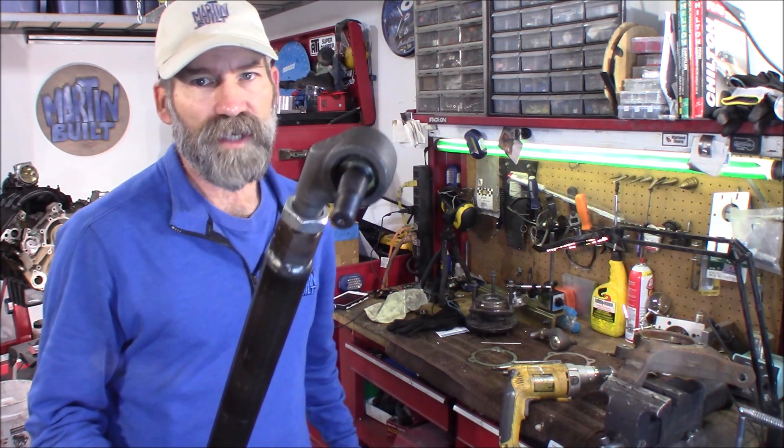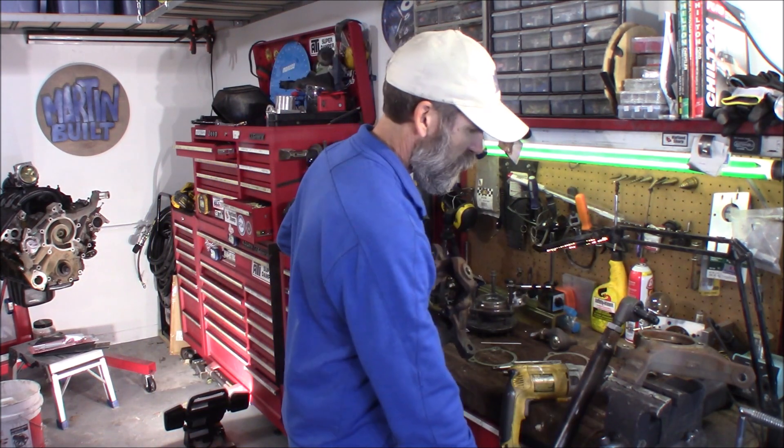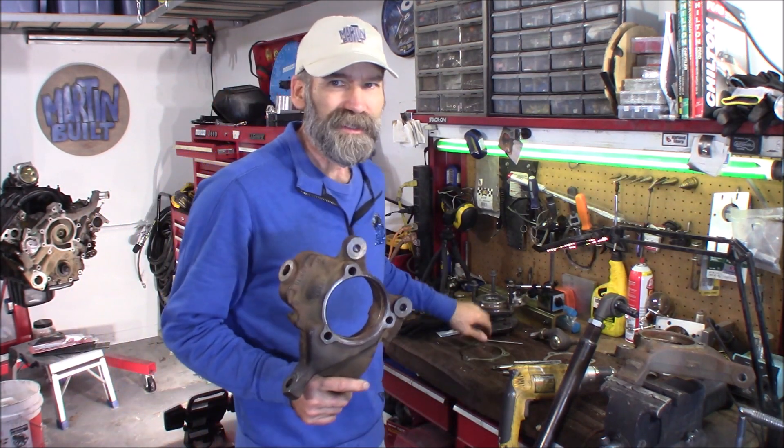Excellent braking. You get the crossover steering. This is a rough stuff tie rod kit. I got this one welded up for a customer and I'm going to go ahead and get these knuckles drilled out for him. And I'm going to do that before I go to the trouble of welding these spacers on here. Alright, let's get started.